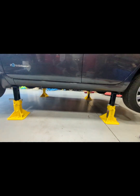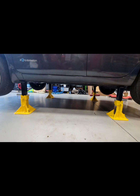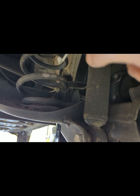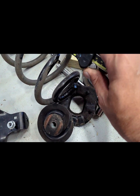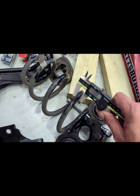Trying to document what we've got going on. Got those 22-ton RV jacks setting this thing up so we've got good clearance to work on it. Got to take off the shrouds now. One question that never gets answered when you're doing a Leaf 62 kilowatt hour battery swap is how much difference is there between the springs on a 24 kilowatt hour battery pack car and the 62. So I'm going to find out right now — using a metric scale: 13 millimeters on the current springs, and 13.7 millimeters on the new springs. So 0.7 millimeters thicker on the 62 kilowatt pack springs — now we know.